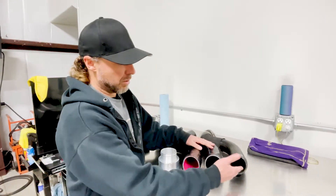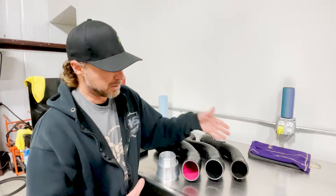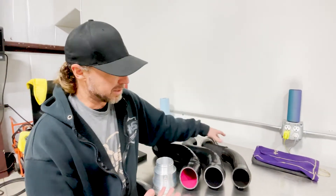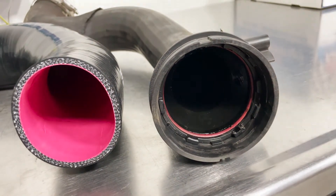We're talking about oil saturating these boots. The crankcase filters on the trucks, people do not service regularly — sometimes they forget or whatever. We found that these boots become super saturated with oil, and the oil actually eats them from the inside out, and that's why they fail a lot.